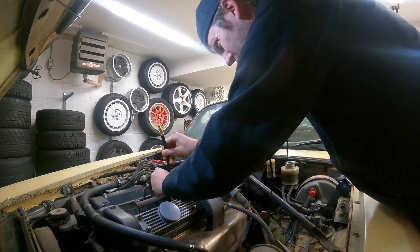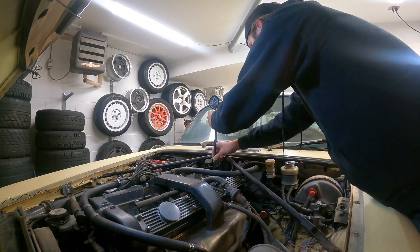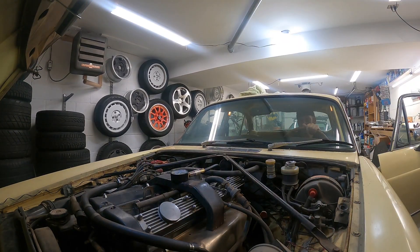If the compression goes up quite a bit after adding oil, that probably means bad rings. This also could just help dissolve a stuck oil control ring. We're going to run it with some more oil in it and see what happens. If you learn anything from this episode and want to see more, make sure you subscribe so you don't miss the next one. So what do you guys think — is this thing screwed or can we make her rip? Let me know.